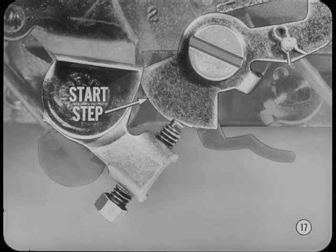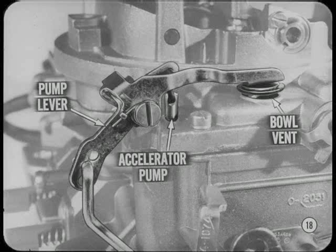Fast idle speed adjustment instructions are also covered in the manuals and are easy enough to follow. Just make sure when adjusting fast idle speed that the engine is fully warmed up and that the adjusting screw is resting on the second step of the fast idle cam, not the start step. The accelerator pump, pump linkage, and bowl vent are the next items on the program. The accelerator pump and bowl vent are both operated by the pump lever, but must be adjusted separately. The accelerator pump adjustment affects the bowl vent opening, so this should be done first.